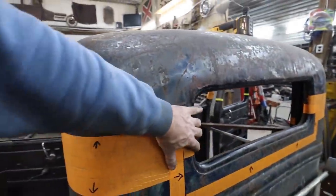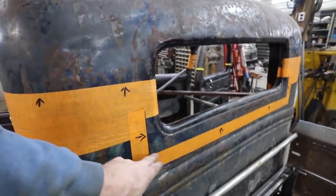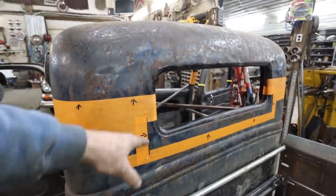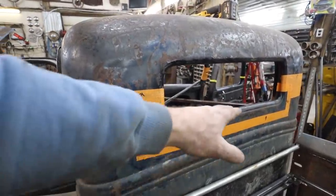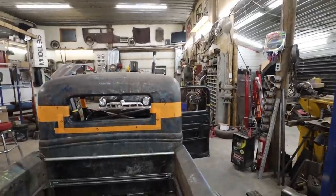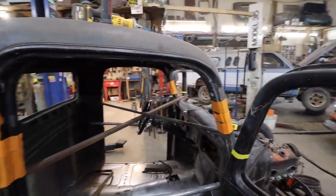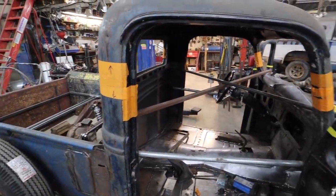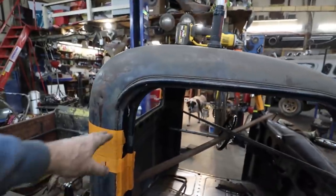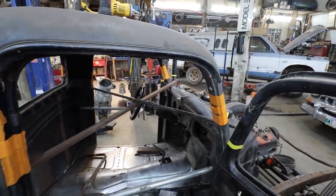Back here, we're going to take our four out of the rear window. Then I'll just cut this and slide the window down into there after. And then we can do the old butt cut at that point over there. The top of the roof and stuff, we'll deal with that once she's chopped down. Other than that, it's going to be a pretty aggressive chop, so there's going to be quite the stretch happening. When this thing goes down, I don't even know if this pillar is going to touch anything at that point. So we'll see how it goes.